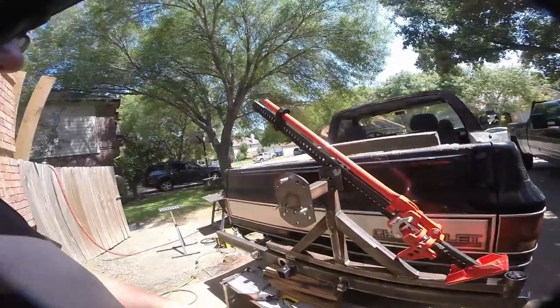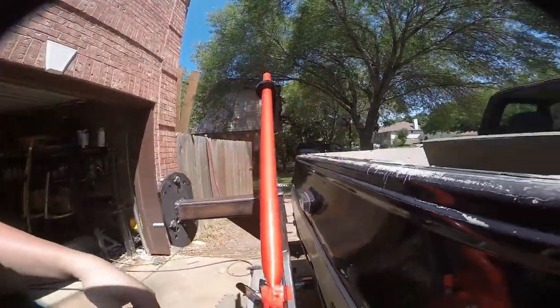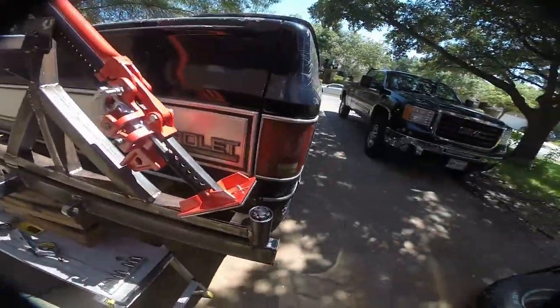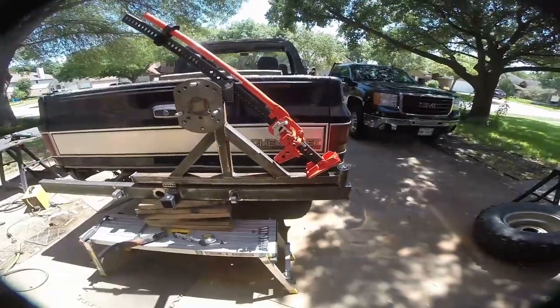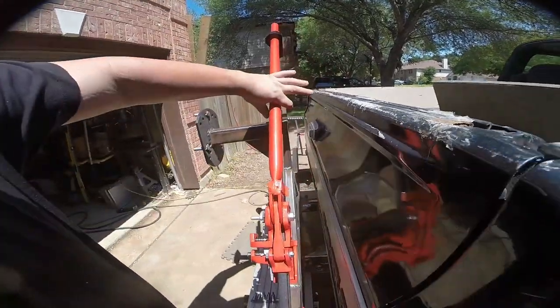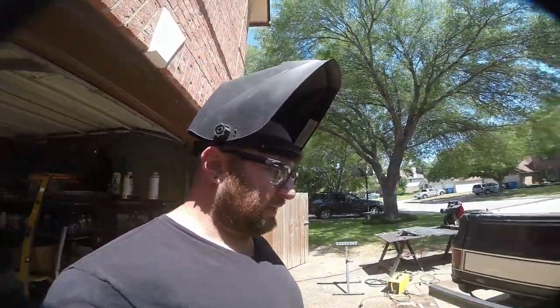Here's our high lift jack mount — we have a plate here with a removable pin and then another plate with a welded-in removable pin, and this will be welded and gusseted down so it can't move. It can move around a little bit in there but it shouldn't go anywhere. In the future this is a standard half-inch pin, so I can actually replace it with a special half-inch pin lock if I'm going somewhere where I'm worried stuff like this gets stolen.